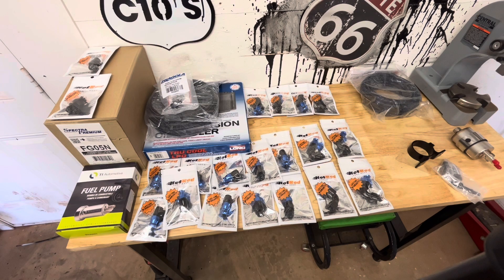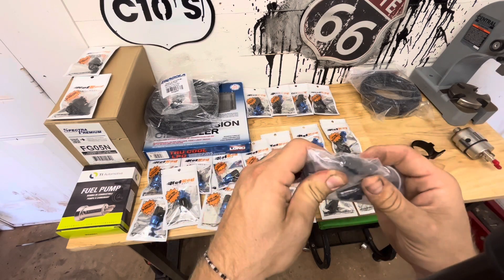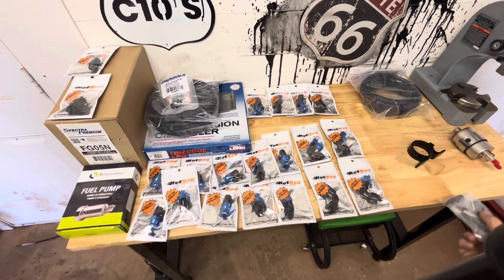Right now all I'm going to do is get all this out of the way so I can start plumbing the fuel system, and I'll try to video that along the way so y'all can see. I just wanted to go over the parts I was going to use for my square body LS swap. Like I said, super simple — everything you need right here will get it running. There is one fitting I forgot to order, which is a 3/8 to a GM quick connect, because I need that for the actual fuel rail itself. But other than that, this is everything you need to plumb an LS fuel system in a square body pickup running one tank. If you like the video guys, like, comment, subscribe — we'll catch you on the next one.